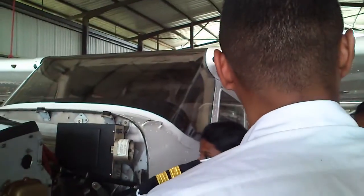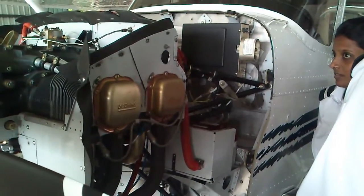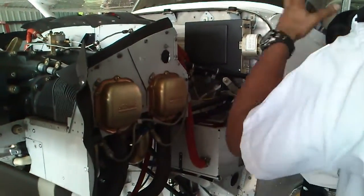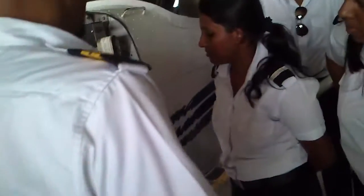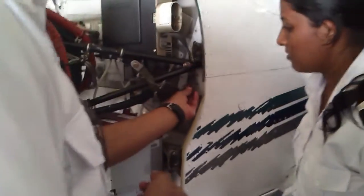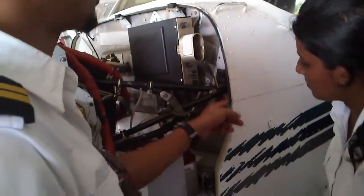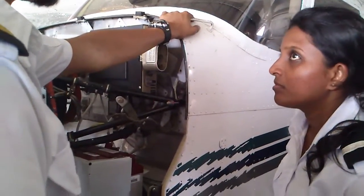Now, talking about electric — single pole, double pole — what's the difference? Single pole: it's earth with the body. Double pole is for aircraft that are usually made from non-conductive materials. As I said, the negative goes in here. But attached to it also, you have one wire going to this, so it's earthing the engine, and it's bolted to the firewall of the aircraft. So this is the earth. But if you touch the aircraft, you won't get electrocuted. So this is a single pole aircraft, for the electrics.